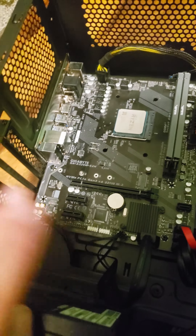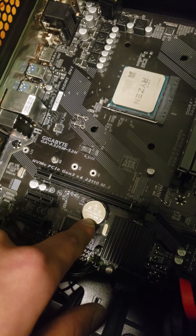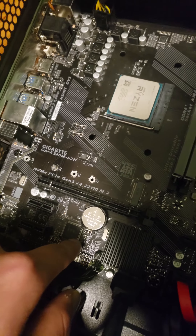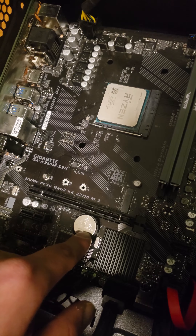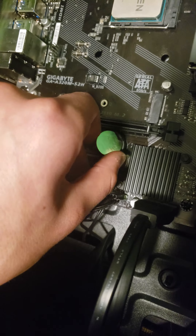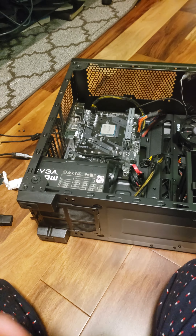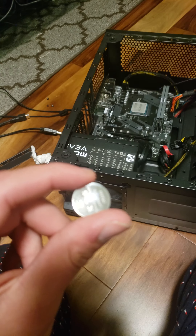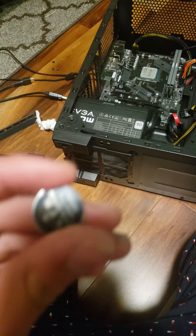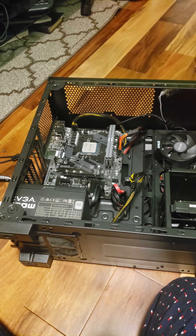First, check if your computer is turning on. After you've done the previous steps, look for this battery on your motherboard — it's easy to find once you know what to look for. All you have to do is unlatch it and the battery comes straight up. Once you have the battery out, hold it out for about 30 seconds to one minute. This is what keeps the motherboard memory in check and keeps it stored, so once it's out, after a bit it will discharge.